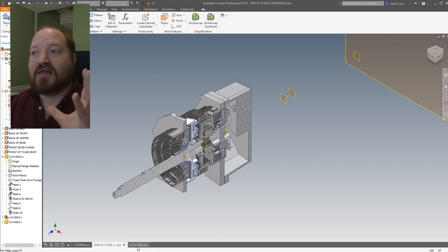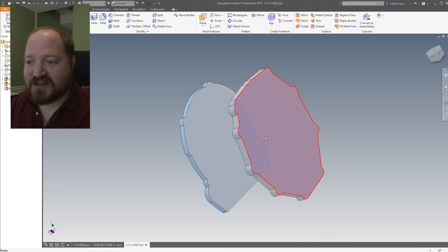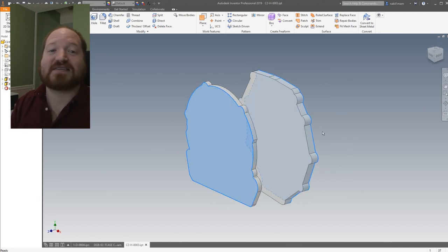I think just by moving everything back half an inch, everything will work fine. I could do things like move the front differential back half an inch, or move the entire engine and transmission up half an inch to get those things back in the same location. With all of this said, it looks like I'll be able to fit all the internal parts of the automatic transfer case behind the manual transmission. That leads to a whole mess of things I need to create, but we're going to leave that for the next video. The next step is to start filling in the space between these two surfaces — that's the housing that I'm going to have to cast and machine.